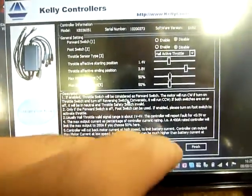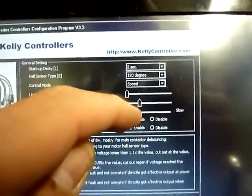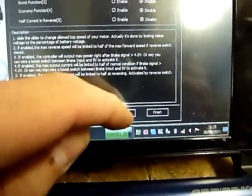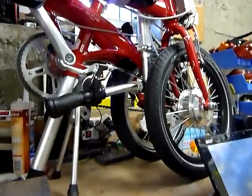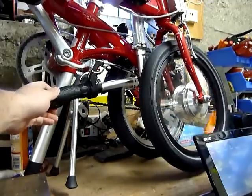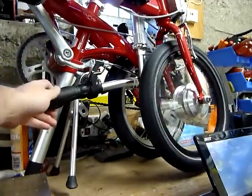Yes. Next. Like this. I move to the fastest throttle rate, like this, and I program the Kelly like this, and okay, I unplug the battery, unplug the USB controller, and plug the battery like this. And then when I use the new throttle rate setting, you have the instant reaction of the accelerator, and not the smooth reaction of the throttle rate setting of 8.